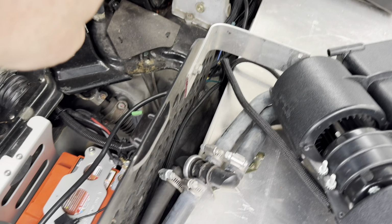So, goes up like that. I'll tighten that when I'm done. I gotta get that top one on there because I don't want this arcing on my wastegate. Anyway, what I was getting to, the plug. This is a 2G Mitsubishi Eclipse motor. The alternator is actually for a 97-98 Galant, but they will fit in a 2G with the wiring harness and everything else. So I had to make a couple little modifications to my coils. I plugged this in because it was the same plug as the Evo 8 and everything else.